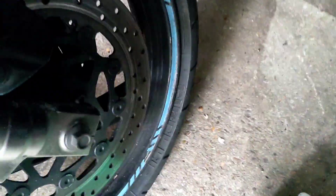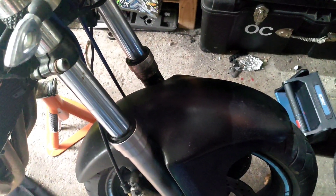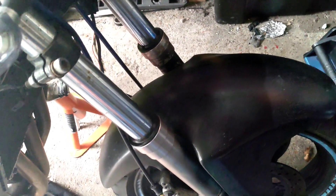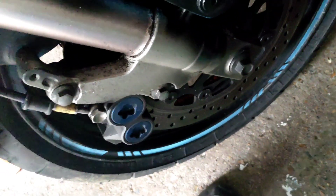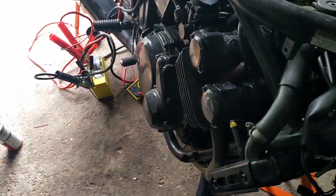I'm waiting on the postman - well, it's Yodel - and I think it's actually the seller taking their time getting it to Yodel, who are normally pretty good when they do get there. What I can do though is - I'm on restrictive movement anyway because these front brakes keep seizing up. So I'm going to start stripping down the front end, take the mud guard off, and have a look at the brakes. They're quite greasy - you can see my thumb mark going through it - which to me says the pads are worn, but at the moment it's binding, so it may just be the pistons needing a clean.